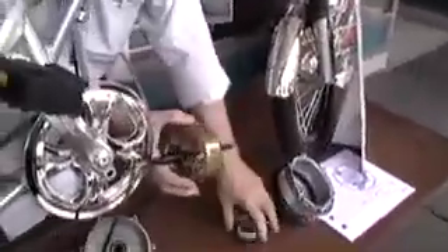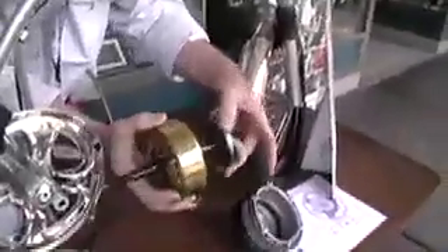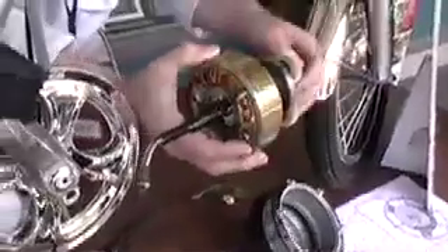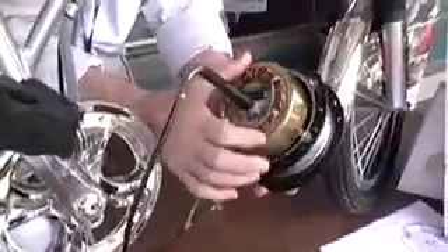Let me show you over here on this motor. These are planetary gears that actually drive the hub. The coil remains stationary on the axle, and the outside part of the case turns around the coils. There are magnets in here that attract and repel the coil, and that forces the outer case to rotate. It's kind of like a maglev train where you have magnets along the track and coils that are turned on and off to propel it forward.